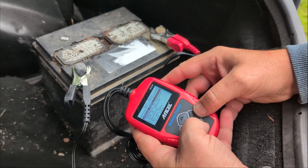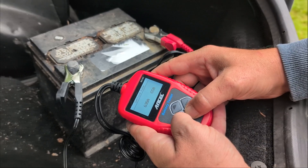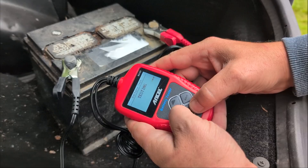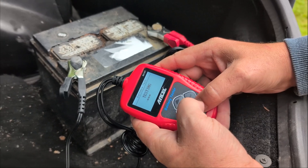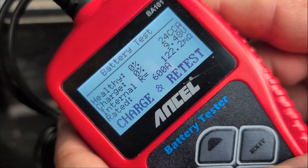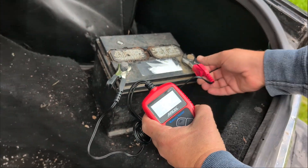This is the battery that was in the car that Greg had replaced. We're going to test this one and select that it's not inside the car. You've got to select all the same things. This battery is a little less amperage — we know it was 600 amps, so we'll change it to that and run the test. It asks before charge or after charge — we'll do before. The result: zero. Only 24 amps. Yep, that's why the car wouldn't start.